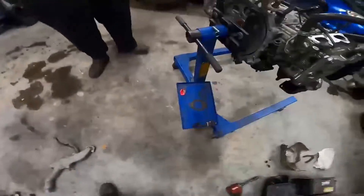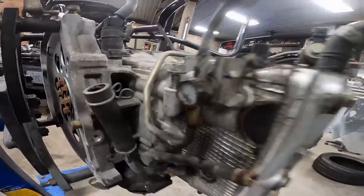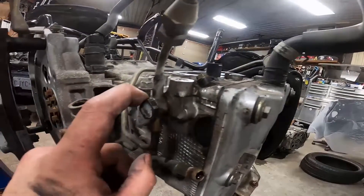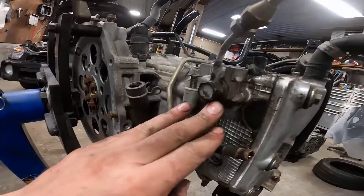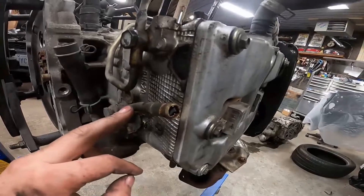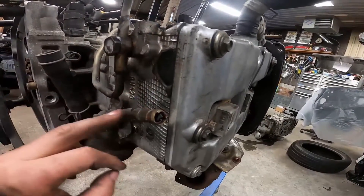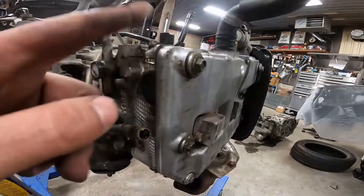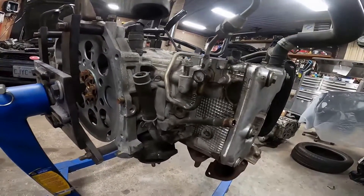Another slight difference is the way the oil feed goes to the turbo - this one comes back out of the cylinder head. On the domestic one this line will be cut off because there is no AVCS. Even the bottom water pipe is a slightly different orientation; the domestic one goes straight up, the JDM one is at a bit of an angle, so use your JDM rubber hose to go to your turbo.